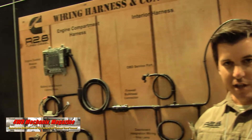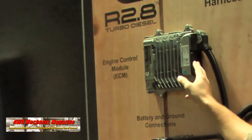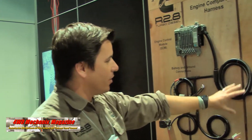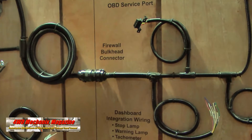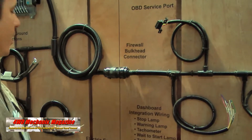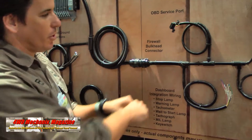In addition to the engine, when you unbox that crate, you've got all this other stuff with you. You'll have your ECM, and there's a second plug — your J2 or vehicle-side harness. With that you see all these leads, including a 27-pin Deutsch connector. So you don't have to snake a bunch of wires through the firewall — you knock out a 2-inch hole, unscrew that, and plug it in.